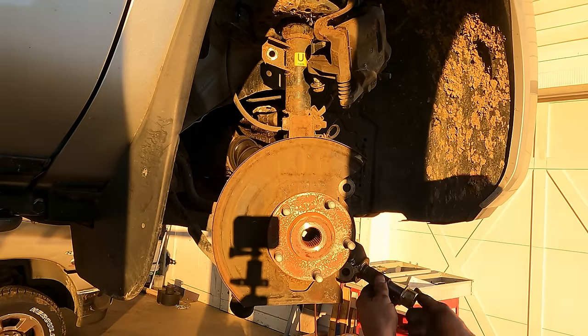Got them cleaned up a little better. And it turns out these aren't just simple wheels. They actually are bearings. And they're down on these spikes sticking out there that have been peened off so they won't come back out. And those just fit into the shape of that so that it allows movement longitudinally. It will always transmit the rotation, and it also allows a little bit of angulation.